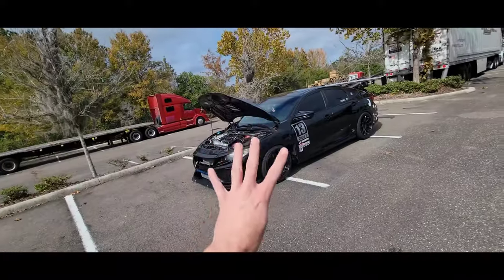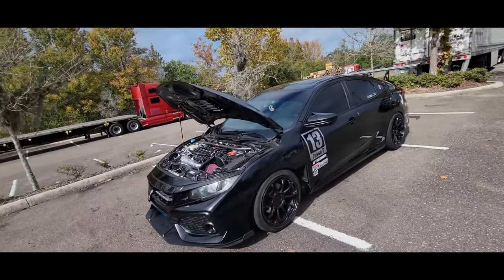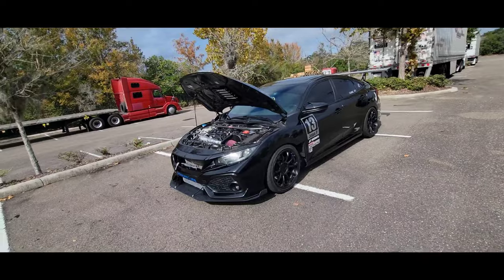The fourth thing you want to do is tune it — especially if you have the turbo motors, because turning up the boost a little bit wakes the car right up. The SI makes around 16 to 17 pounds of boost stock. With the K-Tuner OTS2 tune you can go to 19.5 PSI, 21, or even 23 PSI. Going to 23 PSI — that's plus six pounds of boost — adds around 40 lb-ft of torque and 34 horsepower.